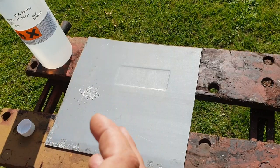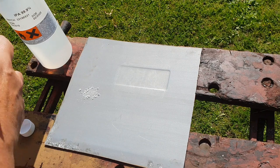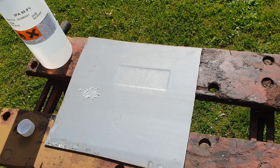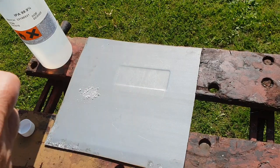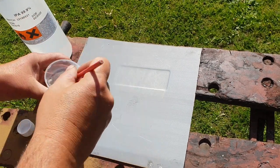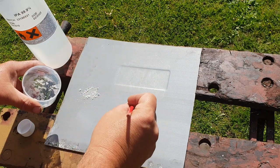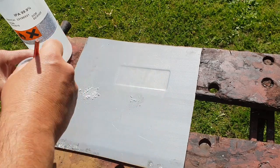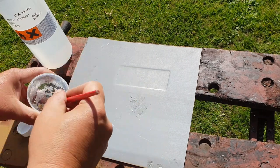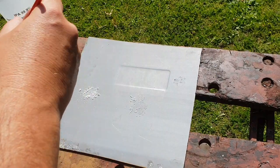We're going to do the paint aging effect. I'm going to have some paint crackle and rust patches on this bike to age it. I've used IPA — which is alcohol, so it evaporates quickly — mixed with some salt crystals to a slushy, snowy type texture. I'm just going to dab it on in random patches and the alcohol should evaporate, leaving the salt crystals behind. It's still quite a big patch — this is just a test piece and we'll see how it comes out.